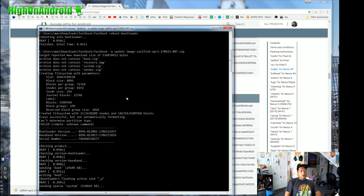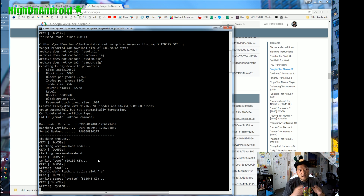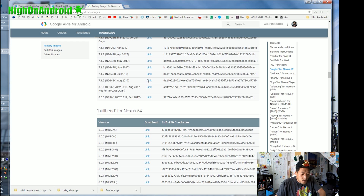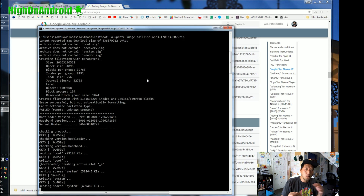You can see what it's doing right now — it's checking the bootloader, which we just flashed to Oreo, also the baseband which is the radio, sending the boot image, and now the system image. Like I said, this is going to erase everything on your phone. Also, if you want to go back to Nougat, you can go back here and download the latest 7.1.2 and follow the exact same process — you will be able to go back to Nougat.